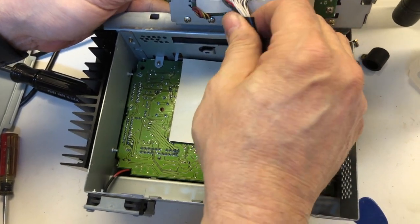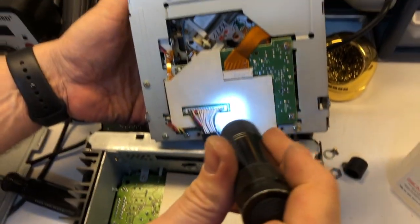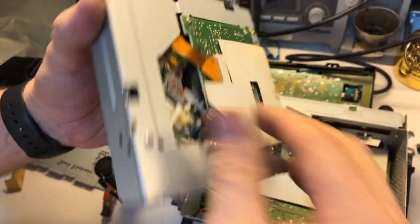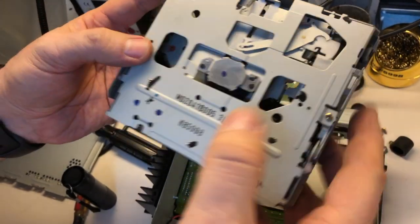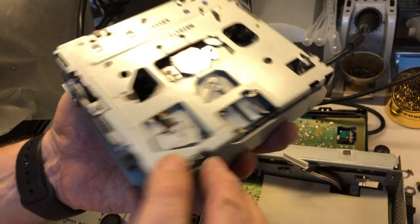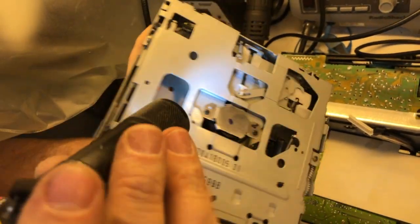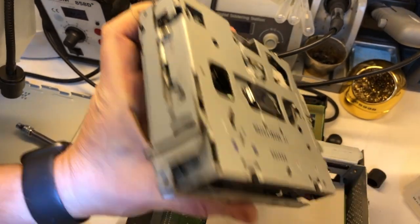This is our CD assembly. If we were a radio shop back in the 90s or early 2000s, we'd just swap this whole thing out with a replacement — but that's not in the cards in 2020. So we're going to do two things: blow some compressed air in here in case there's dust and debris on the laser — and there's a view of the laser right there — and then clean it off with some isopropyl alcohol.